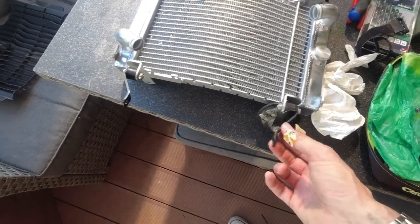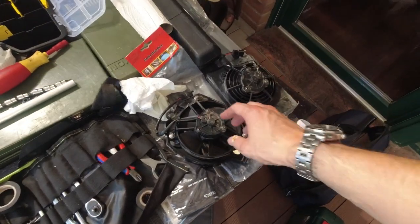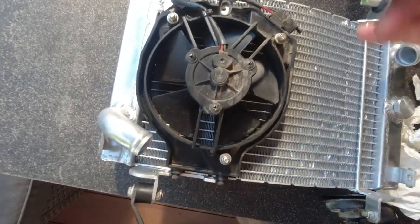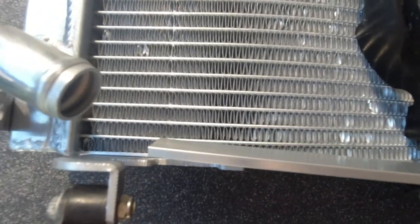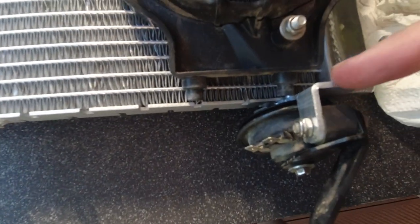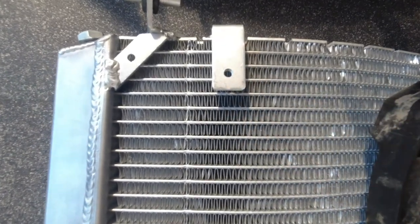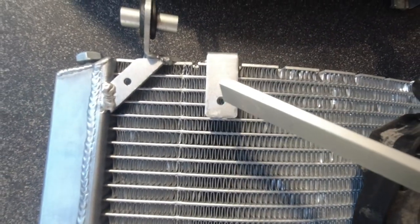Okay, so these pieces are assembled to the radiator. This is finished. So next up is of course the cooling fan, and this one is just over here, and as you already know from the beginning of the video, it doesn't match. And I got myself some aluminium bar, and what I will do is put it down here and do some cutouts or some drillings to make it match with both pins down here, and then fix it with some, I think this is some M5 screw. Over here it was a different one as far as I know, but I will let you know later when I assemble this.